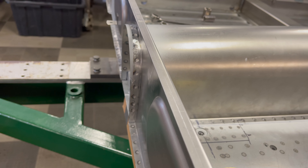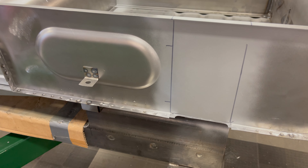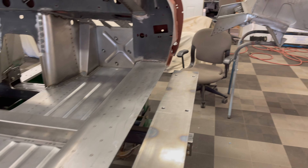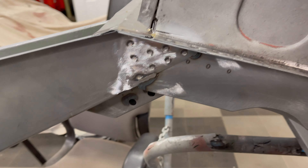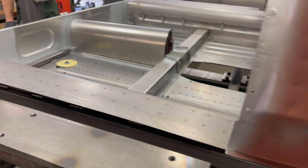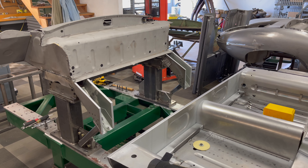Last night I welded in this bar and got everything fitted. This morning I doctored up the drive shaft tunnel by welding in the handbrake pocket, and now we are spot welding it down onto the floor. It takes time to maneuver these just right — you don't want to hit the drive shaft wall. I've got my lines on there, so that's one less thing to think about while spot welding or plug welding. This piece is in here now — you can see where it has been spot welded all along this bottom edge and around the sides. The drive shaft tunnel sticks out a little bit at the top and not the bottom because of the angle of the 90-degree bend — that's exactly how the factory did it. We've got our weld-through where we're mating up the rear chassis leg, and we're going to go ahead and mount the tail section.